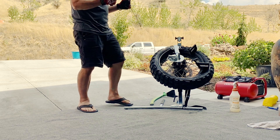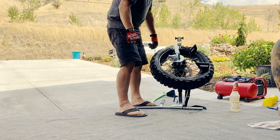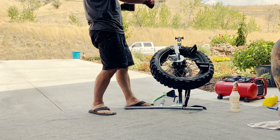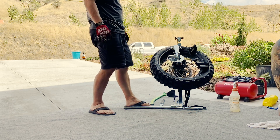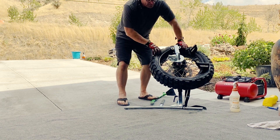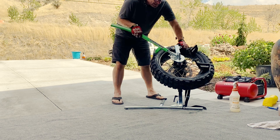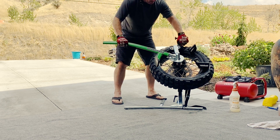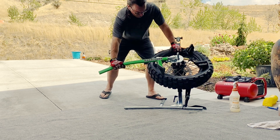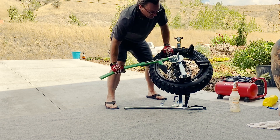The only other thing is if you have a dot on your tire for balance, you want to put it near the rim lock or the valve stem. I've noticed that as you rotate the duck head on, sometimes the tire will rotate on the rim — but if you pay attention and hold the tire with your hand and keep an index of where the rim is, you can keep it from rotating. So we're all set: a couple of drop center tools in place, bead on as far as we can make it, the whole duck head is showing. This is where a good amount of bead grease comes in handy — very important. And it's on.